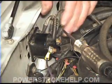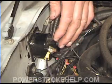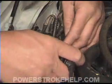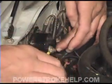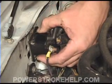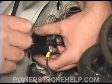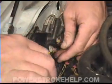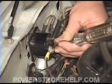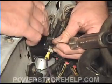Now that you've determined you're getting power to the plug coming into the side of the solenoid from your ignition switch, you want to determine that power is coming out of this end. If you turn the key, you should feel the solenoid go clunk, clunk — you can feel it moving in your hand. If it doesn't go clunk, and if when you turn the key you get no power to this end, then your starter solenoid is bad and you need to replace it.